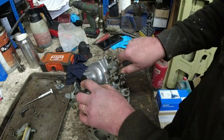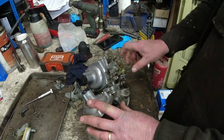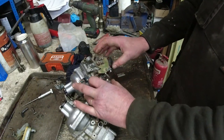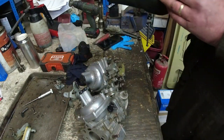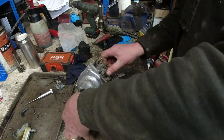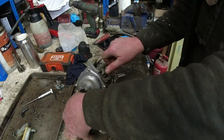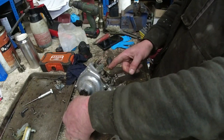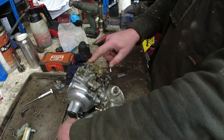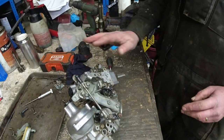I just do these up so they're just tight enough. There should be a nice machined face in there. Checking that the spring on the choke module returns the choke back — which it does, beautifully. I might take this one apart, actually, having just put it on there — just double check. Because it is flicking off quickly, but if I pull it off slowly it doesn't quite fully close up to the gap. It will, with a little bit of finger pressure, but it shouldn't need that.